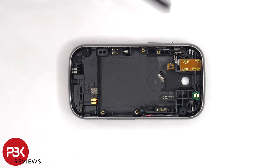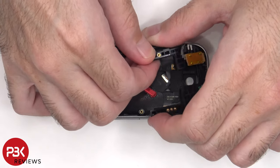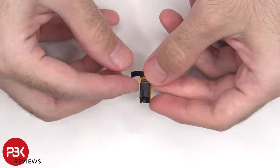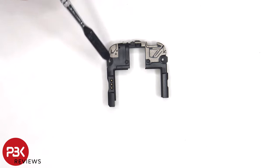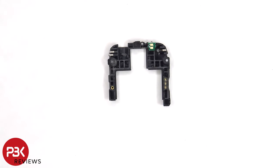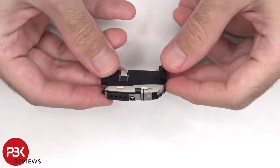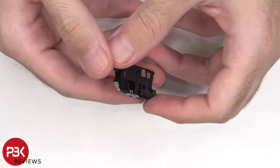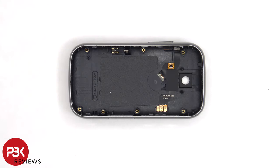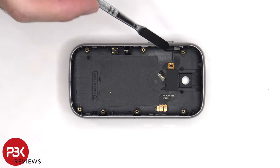This plastic assembly can be removed from the housing. There are some antenna lines drawn on this plastic assembly which are the light gray color lines, and the infrared or IR blaster is located on the other side. The speaker assembly can also be removed. There are some more antenna lines drawn on this plastic cover, and there's a mesh filter and rubber gasket over the speaker opening. The vibrator motor is located on this side, and the flex cable for the LED flash is located here.